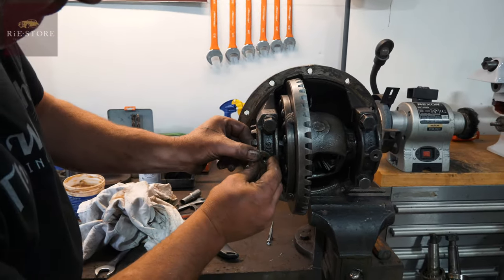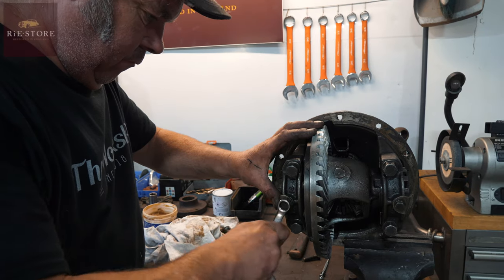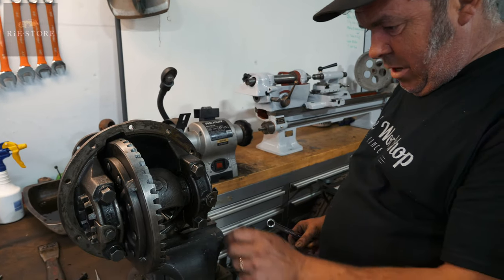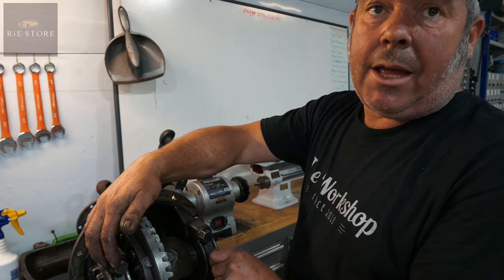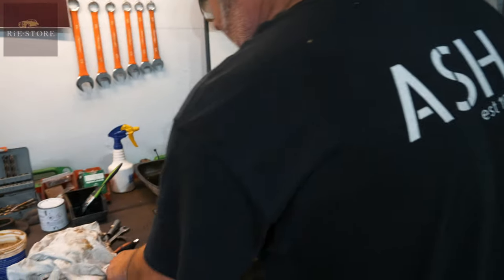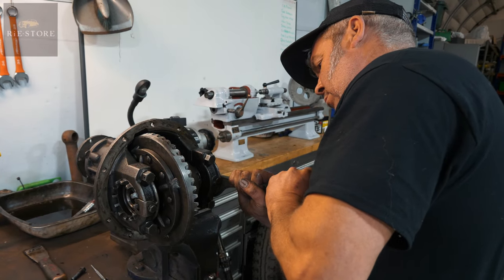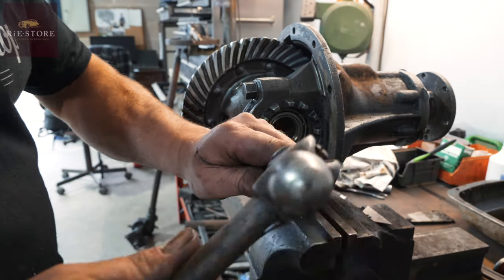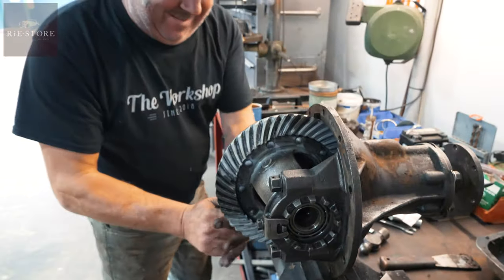As long as you stick to standard settings and get that backlash right, it should be okay — even contact throughout. These are your lock tabs, that'll go in there and stop those moving. Those bolts need a washer on them because they were too long. It's sitting nice — right angles there. They tried to get that in there and bent it, so you can tighten these quite a lot. Just give that a nip — it can't go any further that way because this one's set. Put a bit of tension on the bearing, bring that round in line, and if it can't move now, it's locked up.